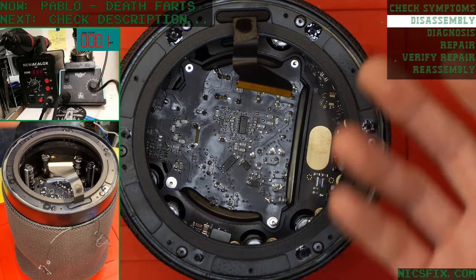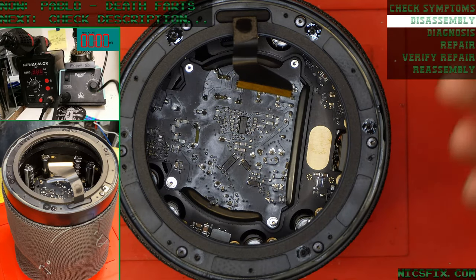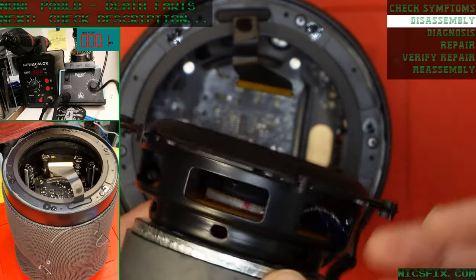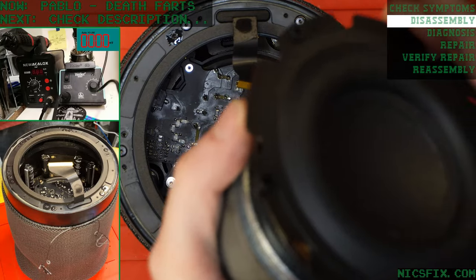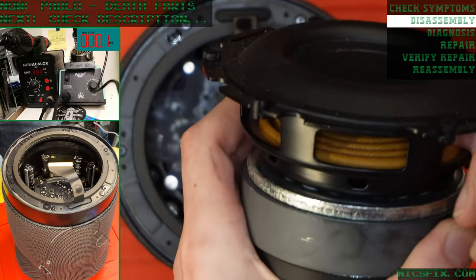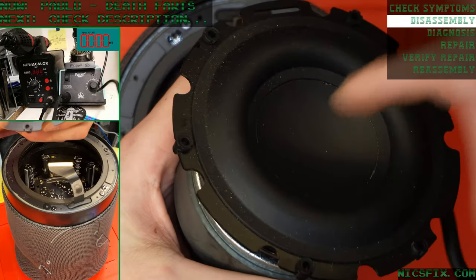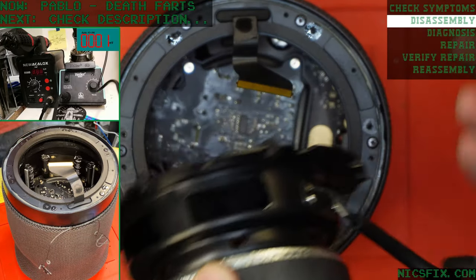The amplifier has built-in protection behavior. When the amp sees too much DC voltage, it forces a restart and plays that loud fart sound. So we want to check, because that can kill the subwoofer. It can kill any speaker over time at too much DC voltage. So we want to make sure that the voice coil looks good. Nice and evenly colored. Still has a nice copper color to it. And then we want to gently push it straight in and out. That feels nice and smooth, and it's not making any strange sounds.